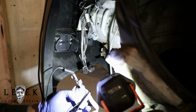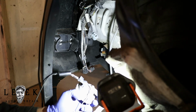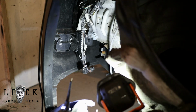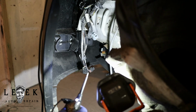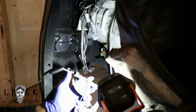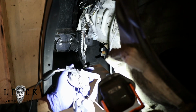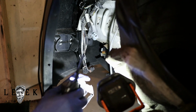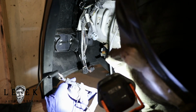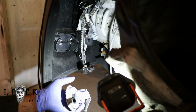So it could be because of here. Let's see. Let's ground you right, put you right here, and see if you will work. Nah, I got the broken wire right here. It's nothing. Nothing. It's open. There's an open. So you got an open circuit like this. What's your next thing to do? I'll give you a second to think about it.